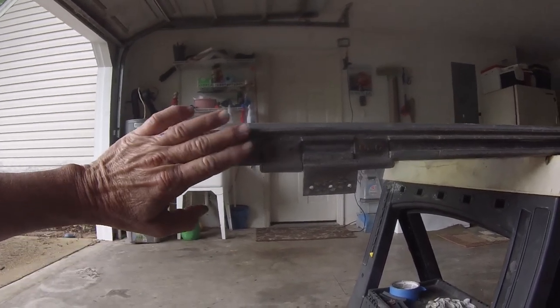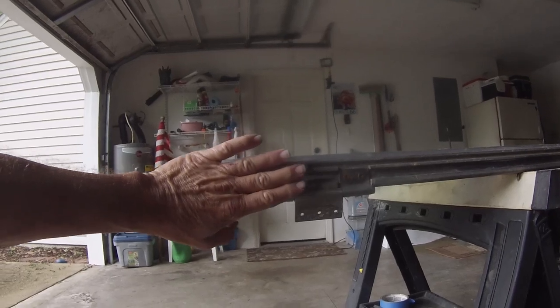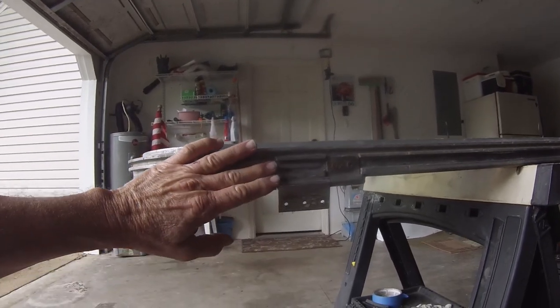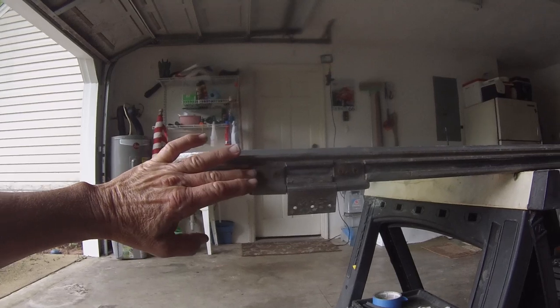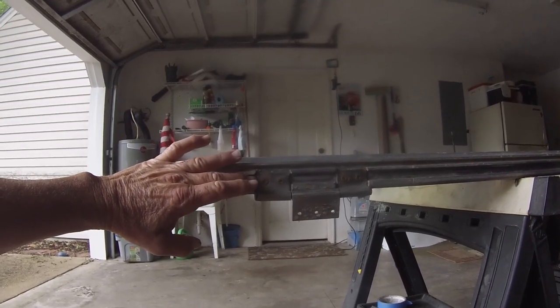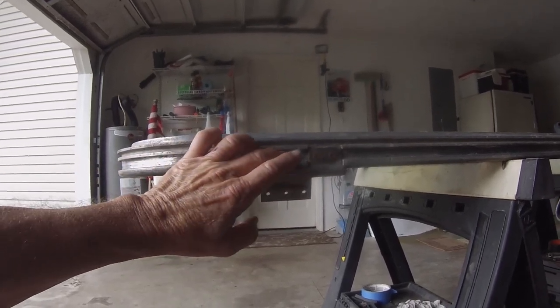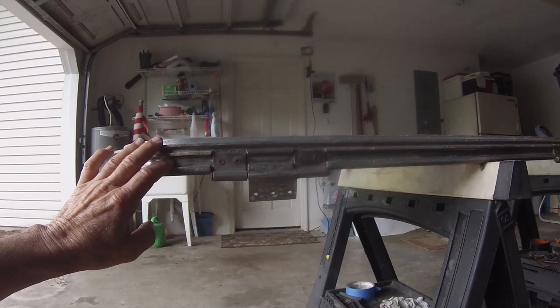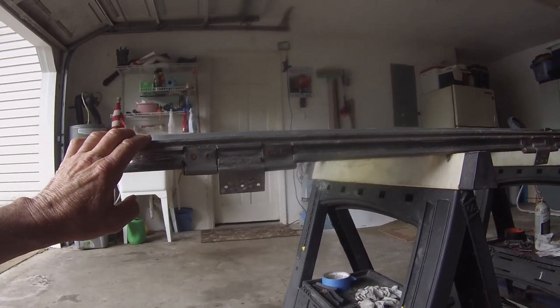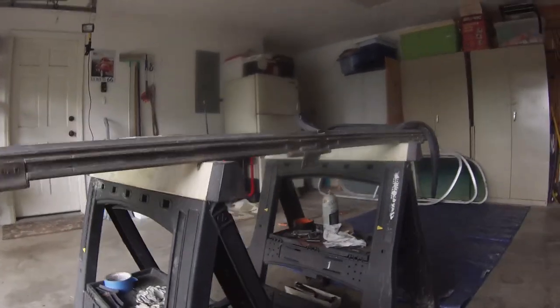And even if it comes up a 16th or maybe an 1/8 of an inch, when you compress it into that window frame, especially if you soak the weather stripping or the seal a little bit, it'll just push right in there. So it's not as hard. I think I made it harder to do than necessary on the first one. But other than that little trick there, it's real simple.